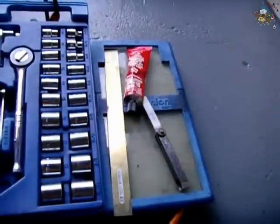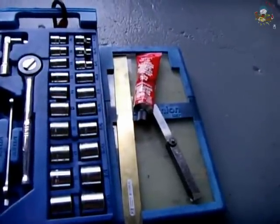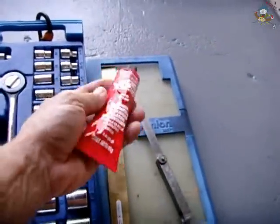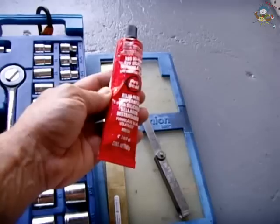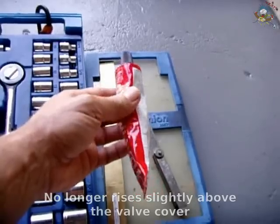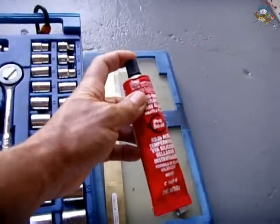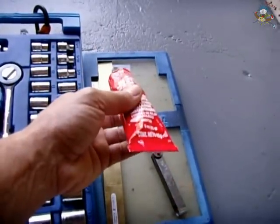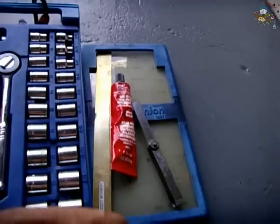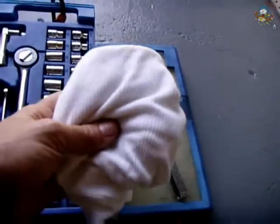When you remove the valve cover there's an o-ring, and that o-ring is actually a rip-off for a Chinese scooter — they charge you like $10 for an o-ring that seals the cover. What you're going to do is use either blue sealant or red high-temperature silicone sealant. In the event that your o-ring is squished and you're starting to leak a little oil, each time I check my valves I put a thin layer over the valve cover with the o-ring and bolt it back down. This $4 tube of silicone will last me probably 50 valve clearance checks.